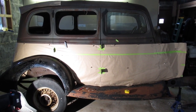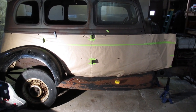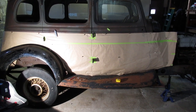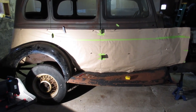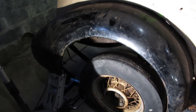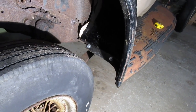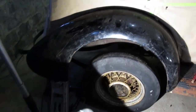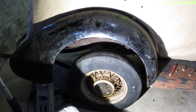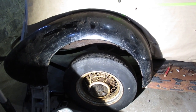All right, we're back. It's been about two days since I did the last video talking about the paper templates. I've got the running boards on fairly loosely. I built new mounts for the rears and I've got them attached to the body. The original mounts were riveted to the frame in two locations and then bolted at a third location. I've got the rear fender kind of hanging on here by a jack on one corner, with three fasteners hanging on to the running board. The way it attaches is there's a flange on the inside of the fender and they use quarter-inch sheet metal tapping screws to go into the body — and that ultimately ended up being the demise of the rear quarters.